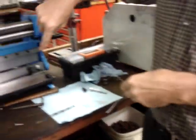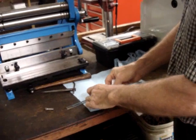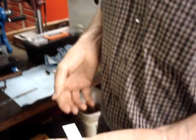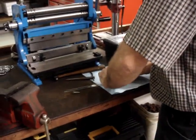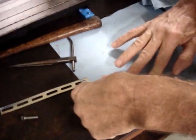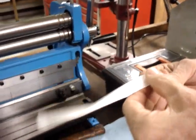If you wanted it to make a flat stock 90 degree bend, you would fold the paper at 45 degrees so that when it's done, your flat stock would look like this. What we're going to do is we want it to head up at almost a 30 degree angle. So if you can see this, we're going to fold it so that it goes like this, and then the end will be bent over